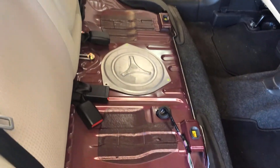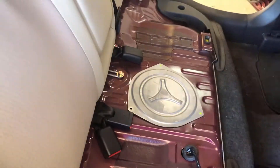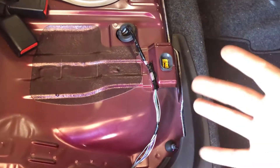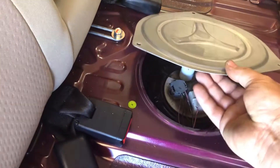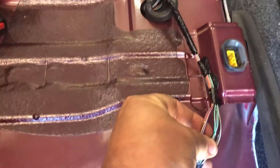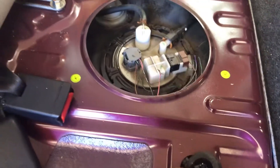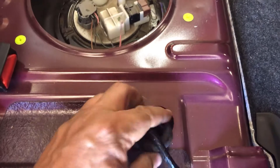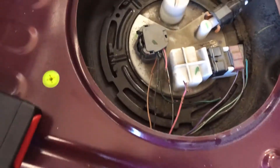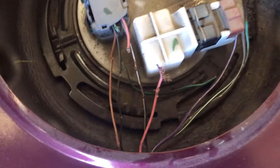They were pretty specific about what they found - they said wiring above the gas tank. At first I came in and was looking at all this stuff and it all looks really good. The car is on jacks because I've been under it everywhere looking. I did unplug the battery before starting any of this. You can see where this wiring group goes out - there's a little rubber grommet right there that seals it off. Rodents got in there and chewed it up - sure enough, that's what definitely happened.